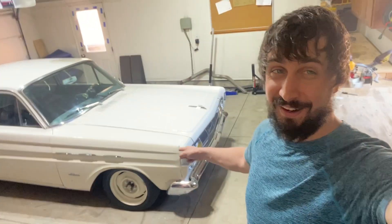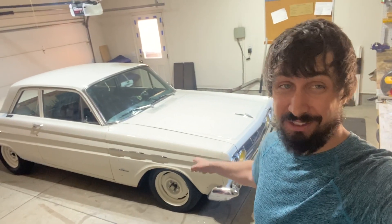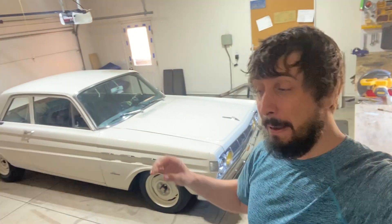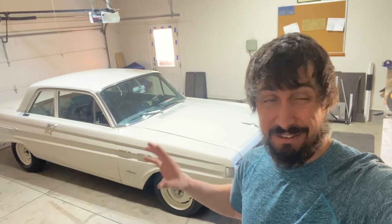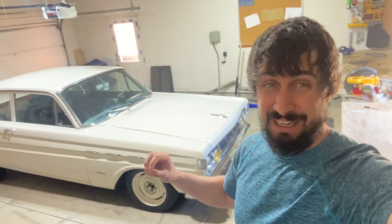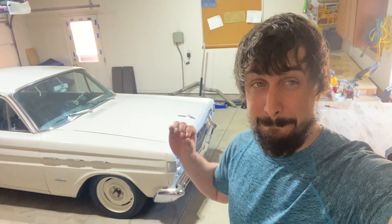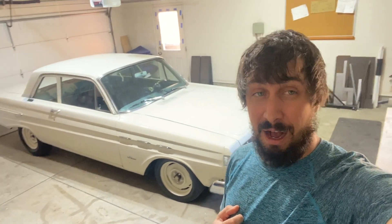Today's an exciting day because we're going to work on the Comet and it's going to all be about teardown and figuring out whether this thing has a flat tappet cam or a hydraulic roller. If it has a flat tappet we're going to save some money but we'll have to really cross our fingers during break-in and it may limit us on power. If it's a hydraulic roller it'll cost a bit more but there's no break-in and we'll probably have more cam options.